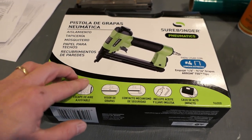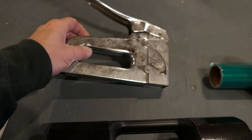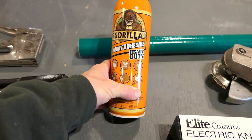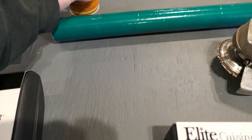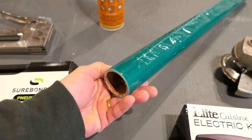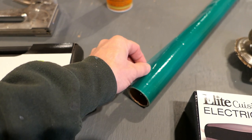You need some way to staple the vinyl cover back on once you take it off. You do not need an air-powered stapler — I run a construction company so I'll have other use for it — but you could just use a regular old-fashioned stapler. The other things we're going to need are some kind of adhesive to put the new foam with the old foam. And then it's nice to cover the foam with a kind of plastic — I'm using something intended in construction to cover carpeting during remodels. It's a self-adhesive plastic, fairly thin but pretty tenacious.